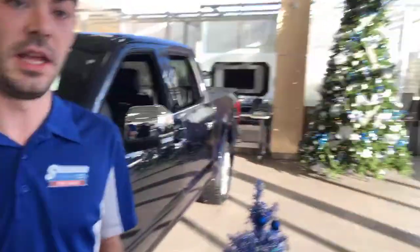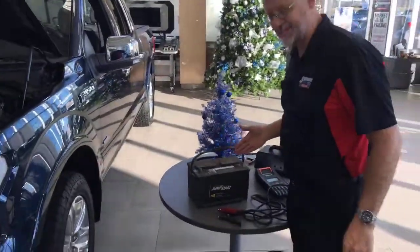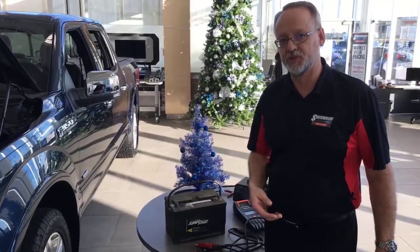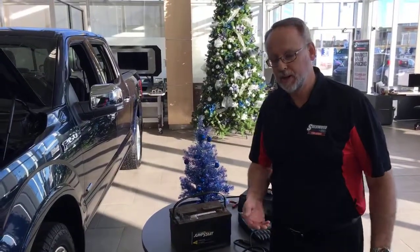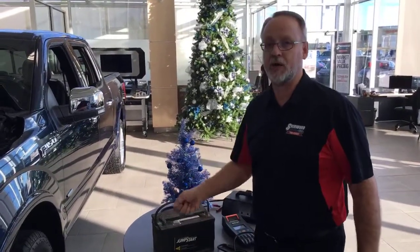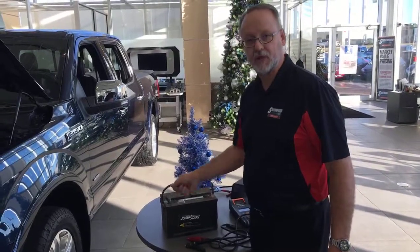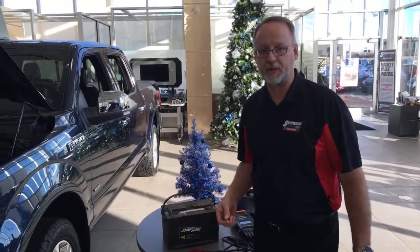Let's talk about cleaning this battery. We've got a lot of corrosion - it's dried-on acid - and this can actually reduce the lifespan of your battery and its performance. It's really easy to do at home. All you need is a solution of baking soda and distilled water. Mix up a little paste, put the paste on, and take a brush. If you're going to use a wire brush, be careful not to connect the two posts because you're going to get sparks. Shine up that post nice and shiny, get rid of all that acid on both posts, then dry it up and keep it nice and clean.